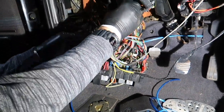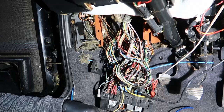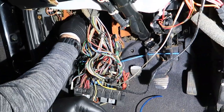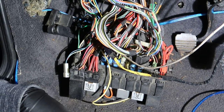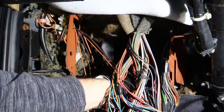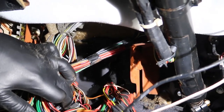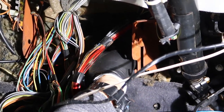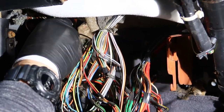What helps a lot with the Volkswagens is that their grounding is pretty much always just solid brown. So if you see anything that's floating around, some standard type of connection, and it's brown, it's most definitely the ground. So we are going to go with the top plug. It's the engine harness stuff on it. Let's take a look at all the wires on the top plug. Look, there's a brown right there. Follow it back over here, super easy, just a ground.